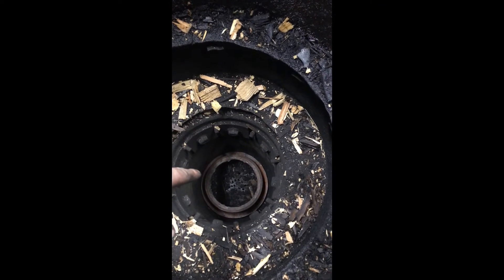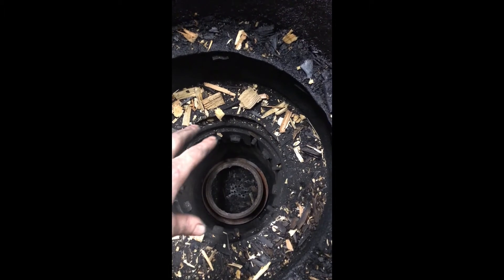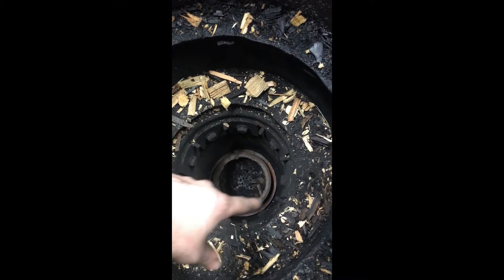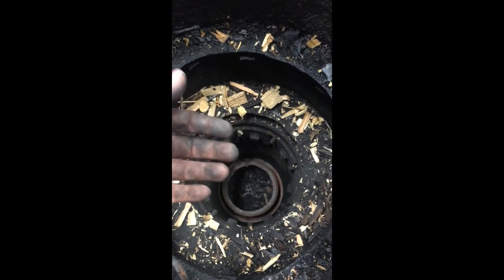Here I've got a bag of fines — everything that I've sifted. This is going to form hopefully the ash cone down around each side, more or less copying how Christian does his char bed break-in, but he uses wood ash. I'm just using my cleanings — I'd call them tailings because they've already been sifted. I fill in all the way around, get a cone formed, and then in this bag I have the other side of my sifting — all my big char — and we'll make up the char bed, bring it all the way up to the nozzles.